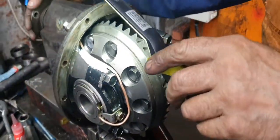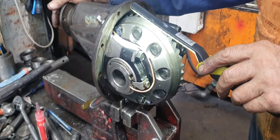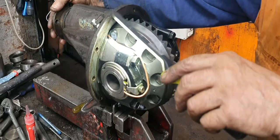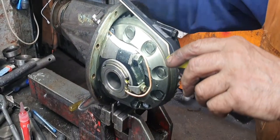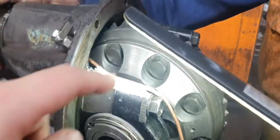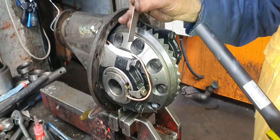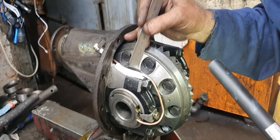I've done it this way many times before, even in Hiluxes, Nissan Patrols, and Land Cruisers — rear Land Cruiser diffs. This is a reverse front diff, a Hilux diff, but they all have these big corners that are hard to get it to pass over, you see. That's clearing up in there now. Have you machined all this? Yeah, I faced it all off at 35 degrees as I just said — you take it off and blend it from about the bottom of the spot facing up to the original point.